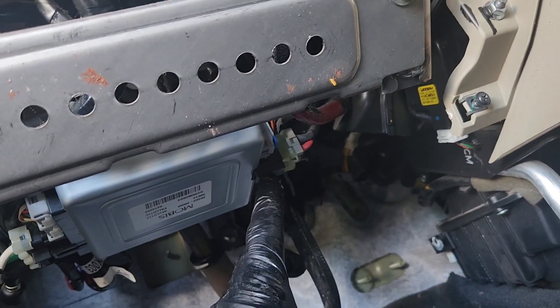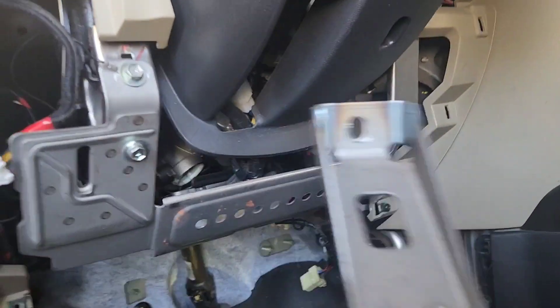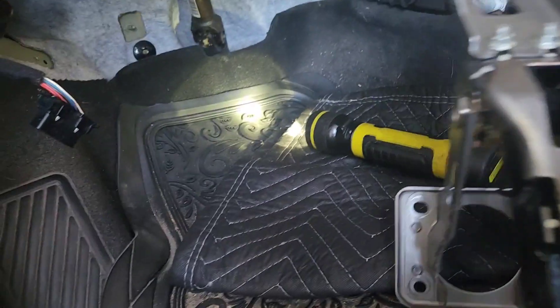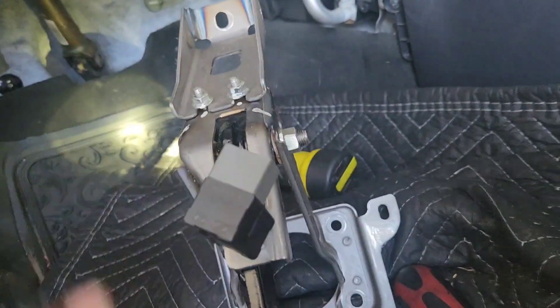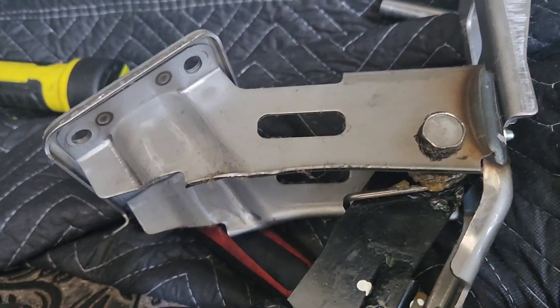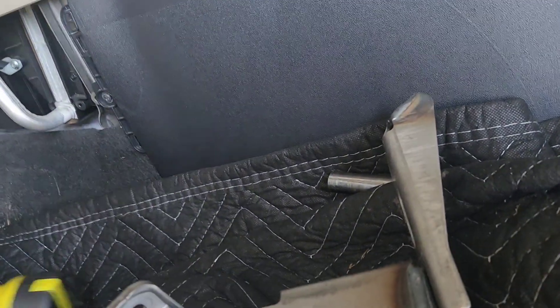I got the four screws off — there's two bolts up in there. I got it off the brake with the cotter pin. We took the brake assembly out as a whole. It goes up in there — there's a top bolt and then four through that bracket. We took the brake wire loose for the brake pedal, and there was a wire harness in here. All you got to do is unclick that off, then twist and pull and bring it out sideways and you'll get it done.